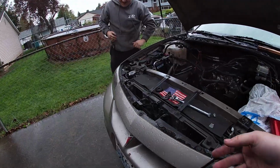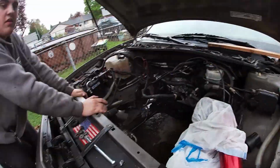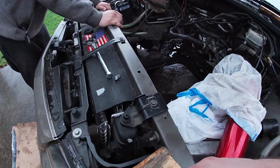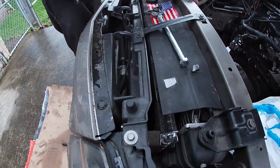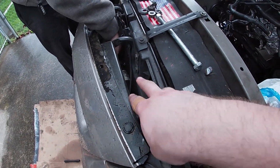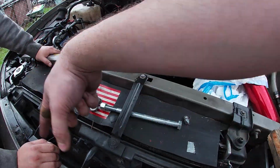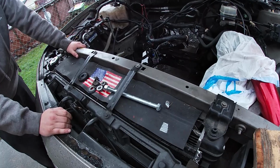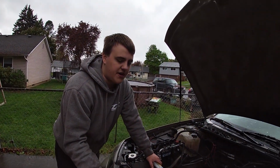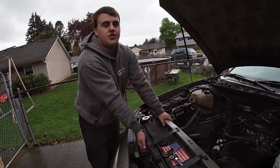Yeah, so I've done lots of research. Since I'm supercharging my Mustang over there, I've done lots of research on air cooler systems and stuff. Tristan got a radiator from a Volkswagen, right? Yeah. Is this it right here? Yeah, that is it. It's pretty decent, you can use it essentially as a heat exchanger. It's like 1 inch wide, with good total diameter. It's specifically why it was used by the person whose build I emulated, because these have really good cooling fins per square inch, which is unique.